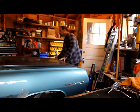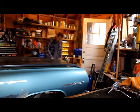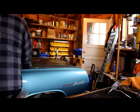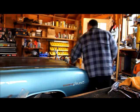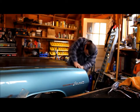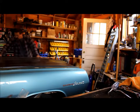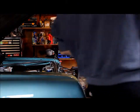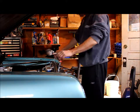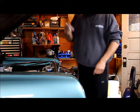Couldn't get any better than that off initial — push this down. You've got your adjustments on the inside. It's just a matter of lining it up. It was way too easy. So I'm going to do the pins right now. In order to get these pins lined up with the hood, I've basically got them set in here and level. I'm not too worried about height right now, just level.